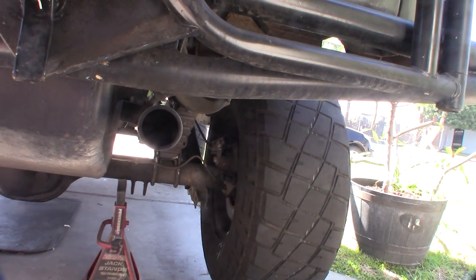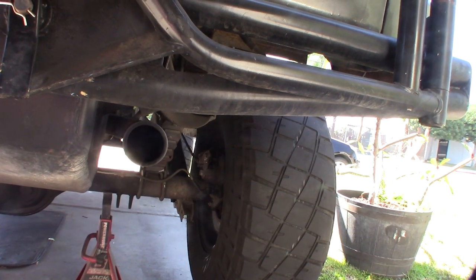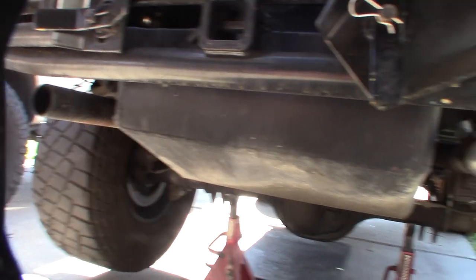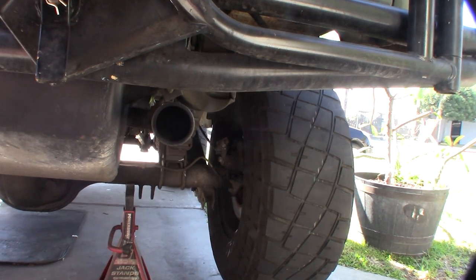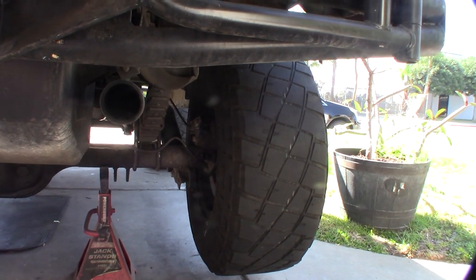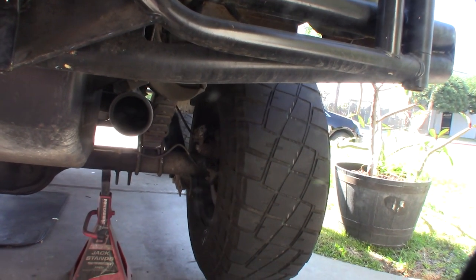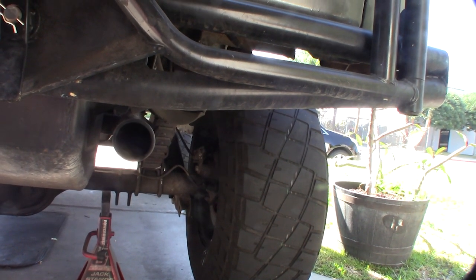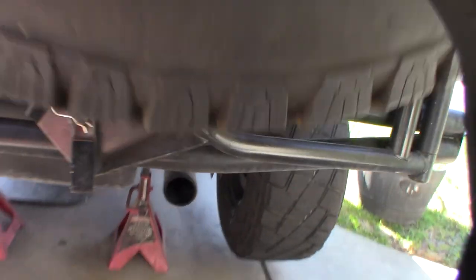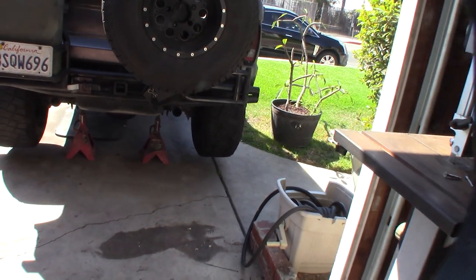Those calipers are probably about 90 bucks each - 57 is the cheapest I can see on Amazon. But if it's not totally jacked up, I've made other videos about rebuilding calipers. Typically you take the caliper apart, clean it out - you can get a cheap four or five dollar seal kit. If there's no major damage internally I can probably just rebuild it. Sometimes debris gets caught in there - these are rusty. I probably put these in when I did the conversion, probably over 10 years ago. This is probably one of the best upgrades I've ever done.